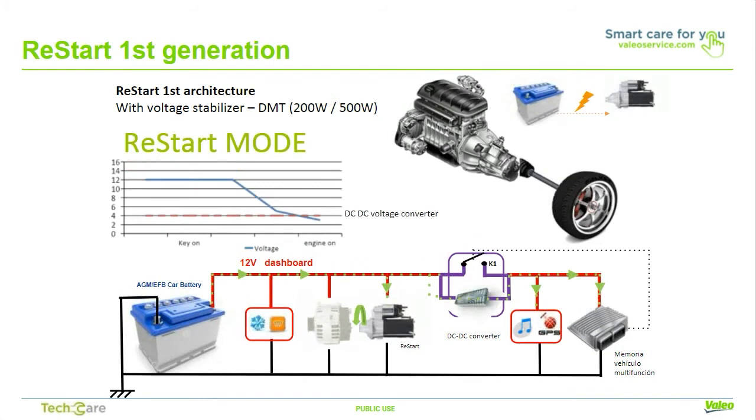The main difference of this architecture is during the restart phase. The car battery supplies high current to the reinforced starter to start the engine and supplies energy to the comfort functions. But to keep the ECU and other electronic control units safe, a specific DC-to-DC converter, like an auxiliary battery, supplies the energy. Using a DC-to-DC converter rather than a standard battery offers three main advantages: switching efficiency is improved; because less energy is lost in the transfer, smaller components and less thermal management are required; and the energy stored by an inductor in a switching regulator can be transformed to output voltages greater than the input, negative, or even transferred through a transformer to provide electrical isolation with respect to the input.